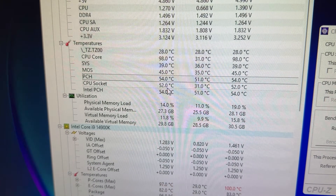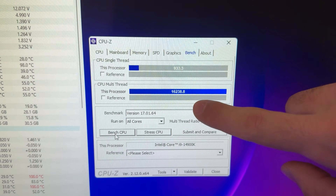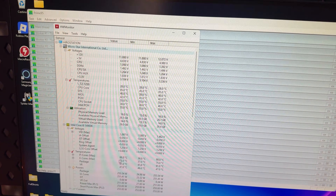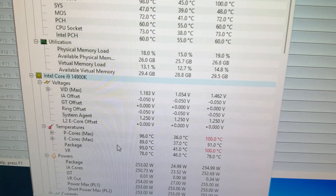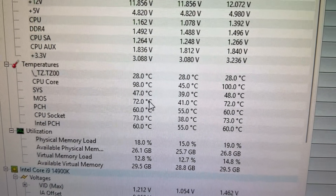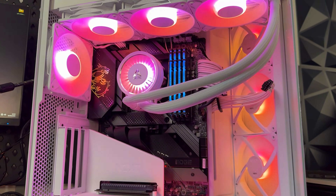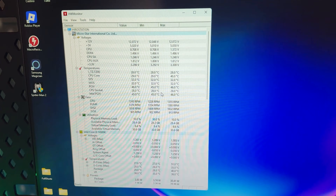The i9s are so hard to cool, and that's the reason why a lot of them were breaking — if not cooled properly they'll last less. As you can see, we were reaching 100 degrees just running a CPU-Z stress test, and in the benchmark we were slightly thermally bottlenecked with power limits unlocked. Running Prime 95, the CPU was dramatically overheating, the socket was running at 70 degrees, and the VRMs were under quite a heavy load.